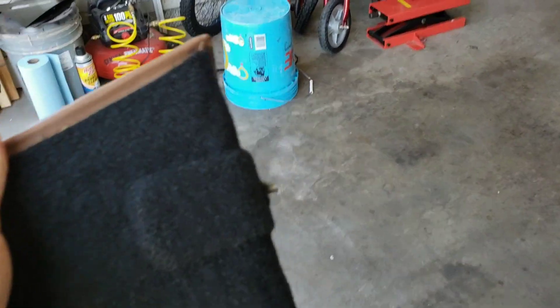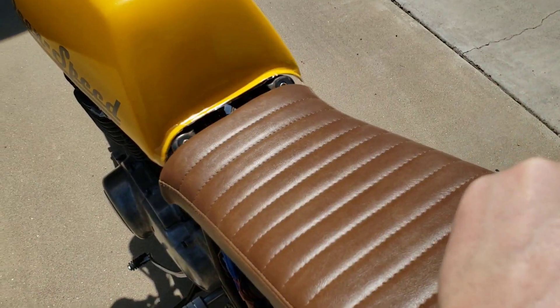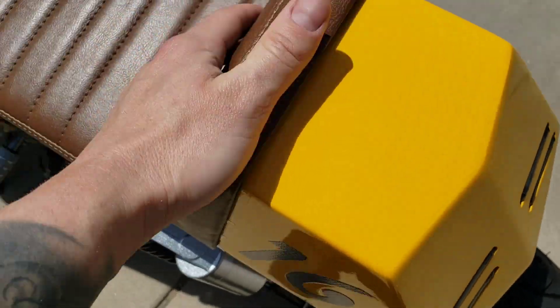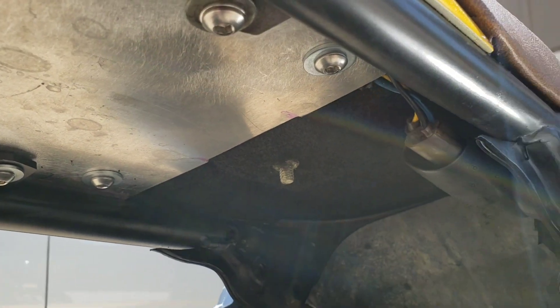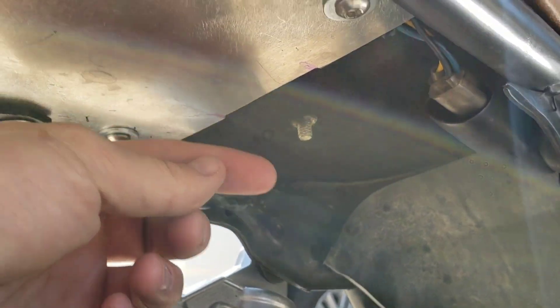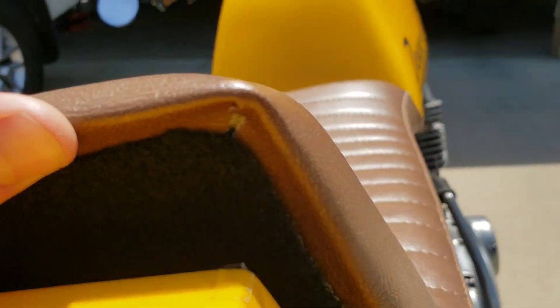I want to show you the seat. I made this seat pan out of fiberglass — it was my first time really working with fiberglass, and I have a video on my channel that covers that. It was upholstered by Rex Simon of Simon Designs. This little threaded post here — when the seat goes on, it fits on the front, and when you set it down on the rear, the front doesn't want to lift. All we have to do is affix the rear: using that threaded post, there'll be a bracket that comes to the tray, shaped so that as you tighten the nut, it pulls the seat toward the tail and seals it up. There's a lip on the seat edge so it encloses the tail, and no one's the wiser.